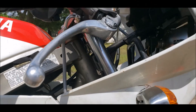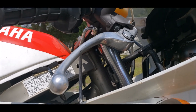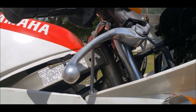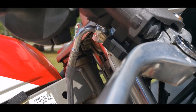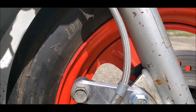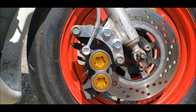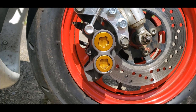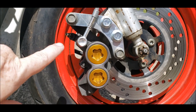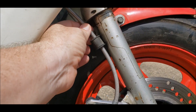On the Spiegler website they tell you how to measure for a brake line, and it's not a straight linear measurement. You really need to loop it around to allow some flex for the brakes, and your forks need to be at max extension naturally. Here's the custom line and the banjo that Spiegler made, and then I went through the stock bushing there.